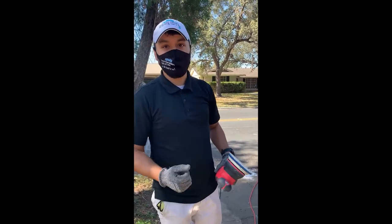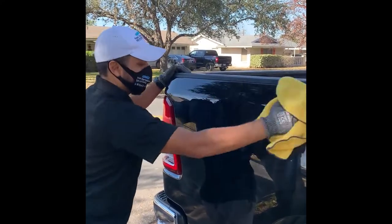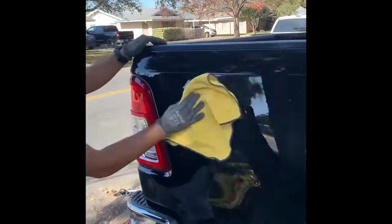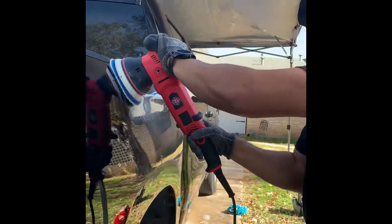It's pretty straightforward but it takes a lot of practice, and your hands will start to vibrate if you're doing it for a really long time. After working in the compound, I can take a look at the paint and see what came out. It actually looks pretty great — there are no defects I can see. Another thing: if scratches are deep enough you might not be able to get them out, but you can blend them in, meaning the scratch will still be there but you'd only see it at a certain angle because it's blending into the clear coat.